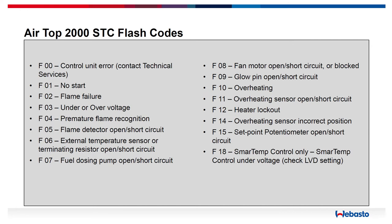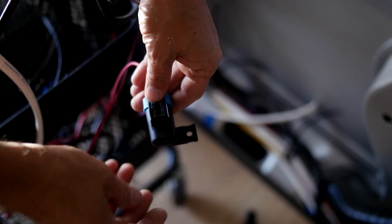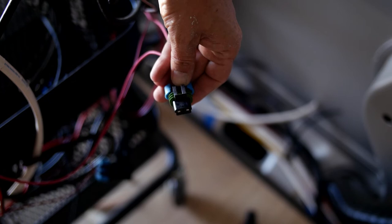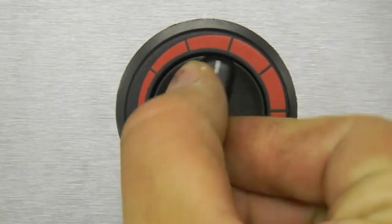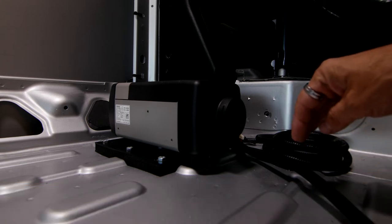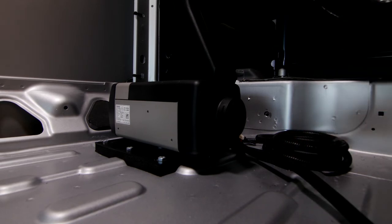There's a complete listing of all fault codes in your manual. You can clear a fault code by simply turning the heater off and on again. However, if you experience seven consecutive fault codes in a row the heater goes into lockout mode. To reset lockout mode: one, turn the heater on with its controller; two, while still on, remove power by pulling the fuse in the main wiring harness or at your branch circuit; three, wait ten seconds; four, turn the heater off with the controller; five, restore power by replacing the fuse; six, turn the heater back on. Also note: when the heater is on, the fan will always be running constantly even when not heating — this is normal, it's very quiet and uses very little electricity.